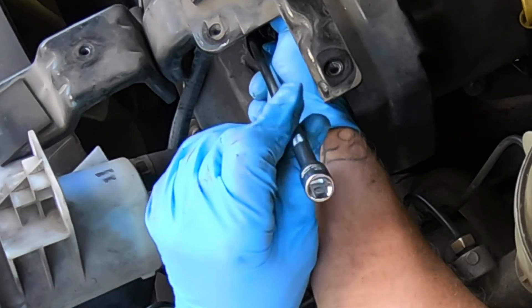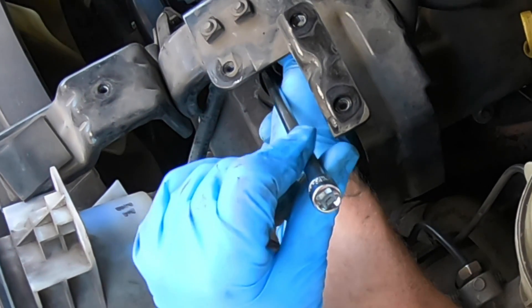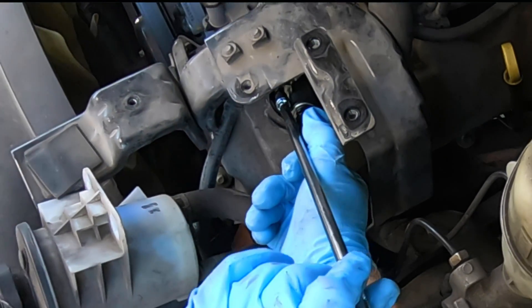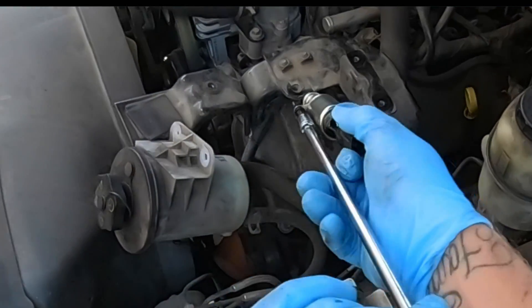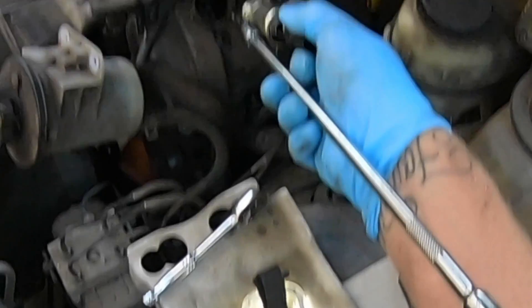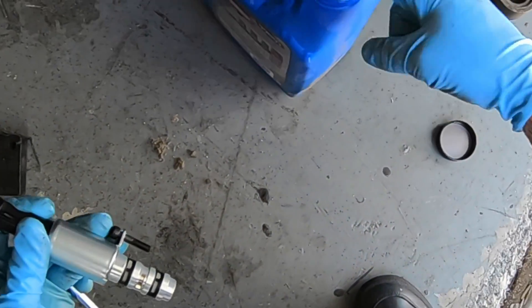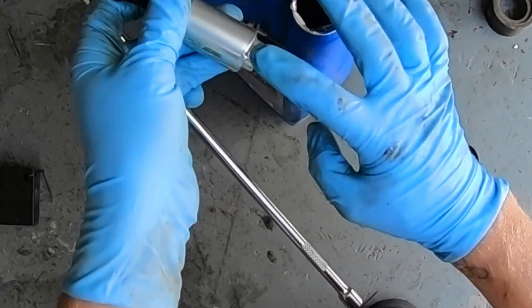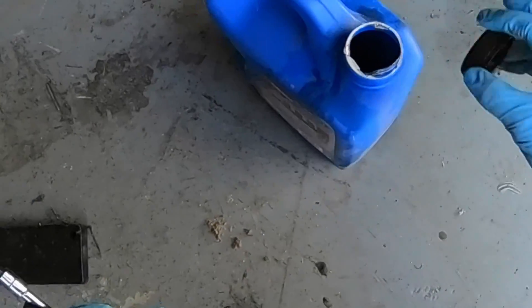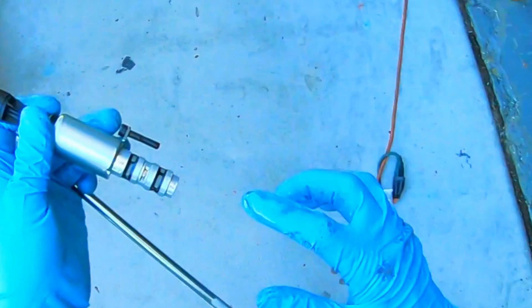You can see I'm being very careful pulling on the solenoid as I'm loosening the screw — I don't want to drop that screw into the valve cover itself. I'm pulling it out all as one piece, as an assembly. What these solenoids do is make your vehicle a variable valve timing engine — they control the oil going to the camshaft timing gear, causing the vehicle to retard or advance the timing depending on load and speed. The computer knows all that.